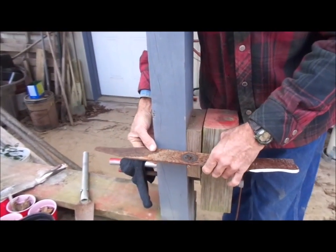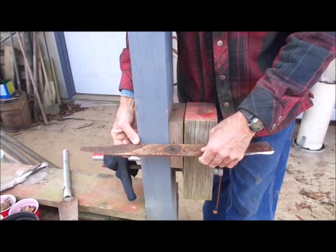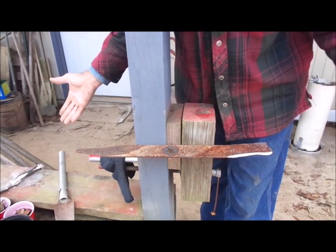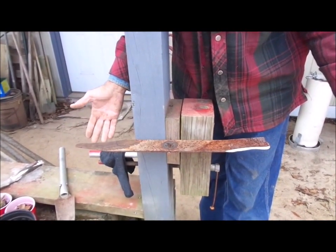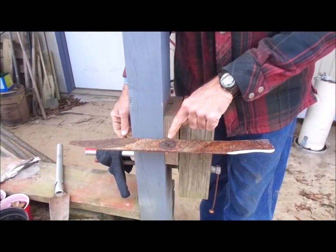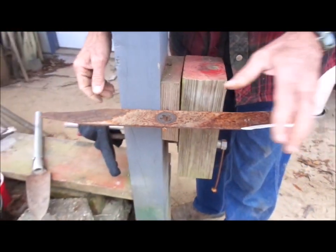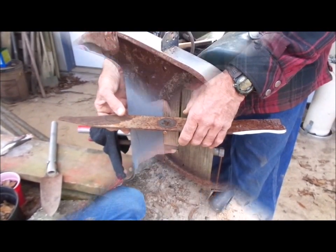We've got our grinding done — let's put it on the nail and check. It's perfectly balanced, right in the center. That's what you want in a lawn mower blade when you're sharpening it: exactly the same amount of weight on each side so that it doesn't vibrate when you put it underneath the lawn mower and ruin your bearings and pulley system.